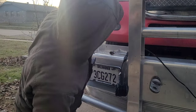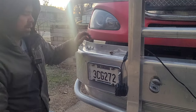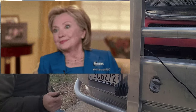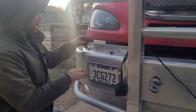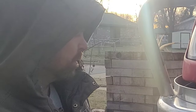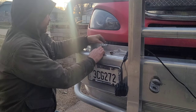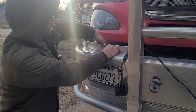That was easy enough. Let's get these mounted before it gets dark — I don't know if I'll have time for the rest of the lights. Got our thread locker here. I always want to put thread locker on parts that get a lot of vibration, and this front bumper definitely gets some. I want to put the bolts from the front back — that's what'll look best. We'll put the bracket up, then washer on the back and spin the nuts on the back side so we don't put marks on the bumper.